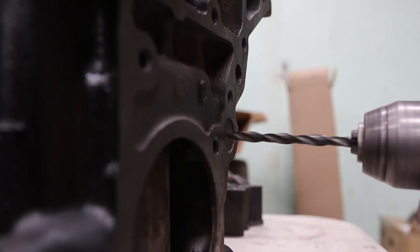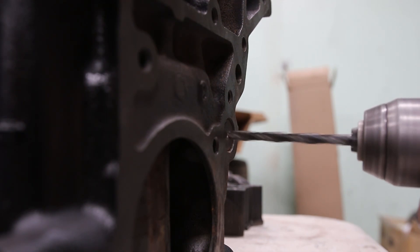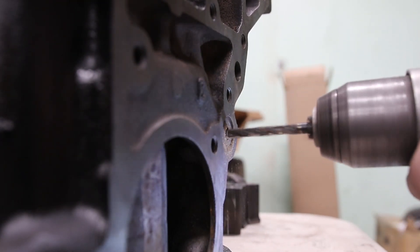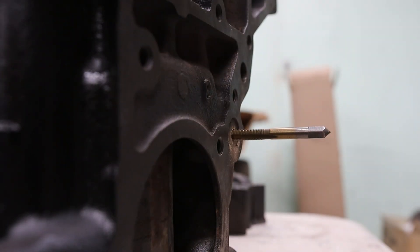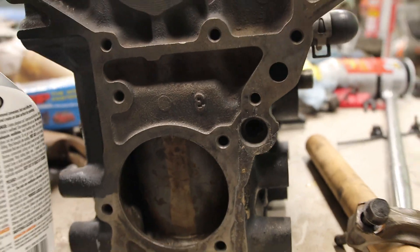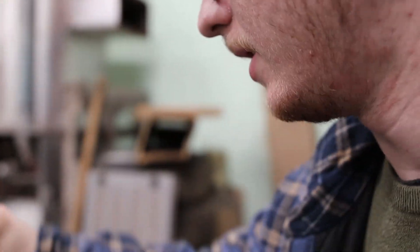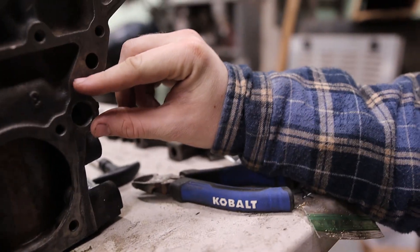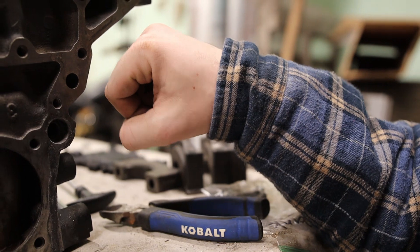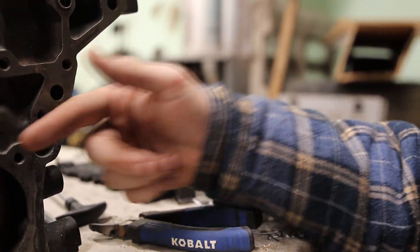I am back. It's been a couple of days and I got that plug out. I got the new one right here — genuine Mazda. You can see that hole is now a hole with no plug plugging it up. I put a socket bigger than the hole, then I threaded a bolt into there with a nut before the bolt, and that allowed me to spin the nut that extracted the plug and it popped it all out — and that worked perfectly. Shout out to Mr. Price for helping me with that.